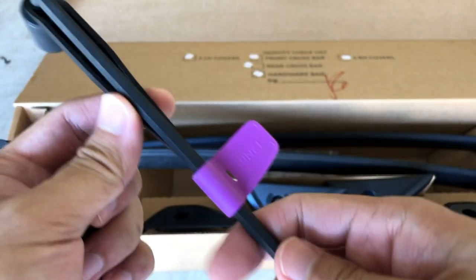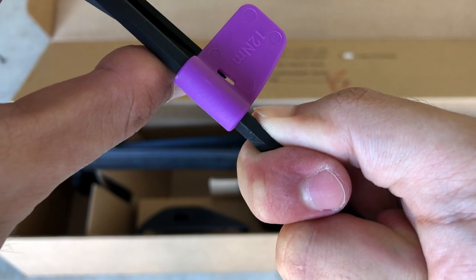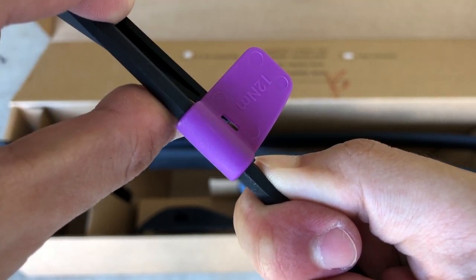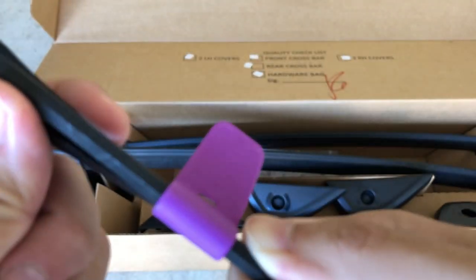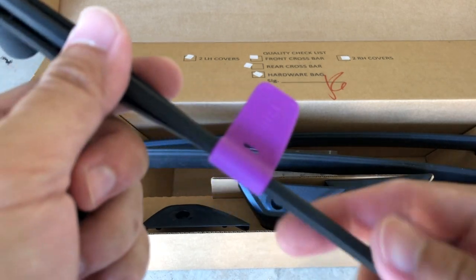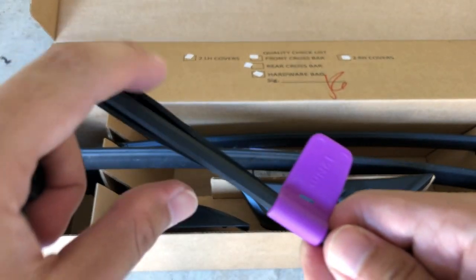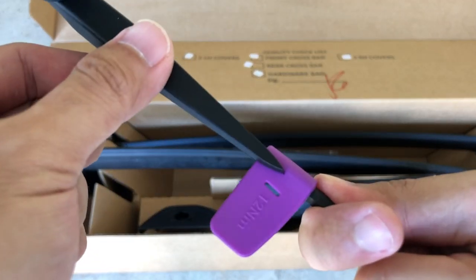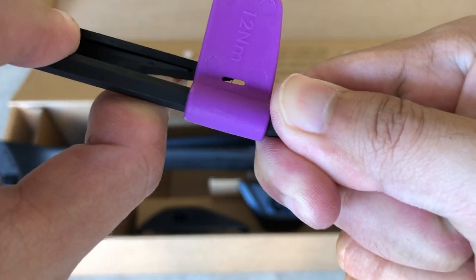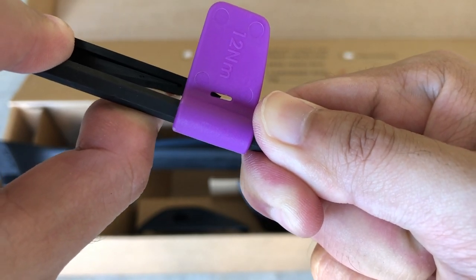So when you tighten the bolt, this needle here is going to go right there on the hole, and when you see that, that means that's it, it's tight, do not over tighten. So that's what's nice about it. You can also use your own. If you have a ratcheting socket, you can use that as a starting point, but when you're about to finish tightening them up, use this one and use this pressure gauge. That way you know how much to tighten. And as soon as that needle goes right there in the hole, you can see that needle, that's it. Do not tighten more than that.